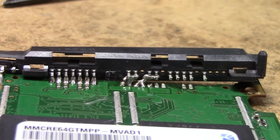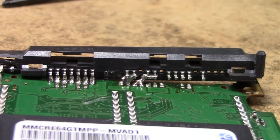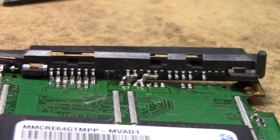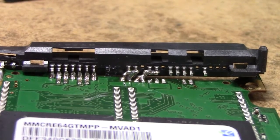There we go, there's the finished adapter. I should only have to solder those two pins on the power connector since this thing seems to run off of 3.3V. Now the big question is if whatever computer I have actually has 3.3V rated, but I suppose we'll find out.